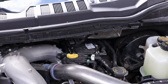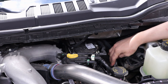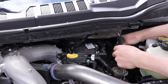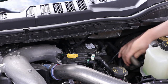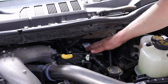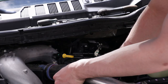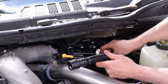This is my first time doing this along with you guys. There are two fuel lines here — a return line and another one. These clips you just have to pull the little white deals and they'll pop out of the way. Then we've got to pull these off. There are a few bolts — 10 mil head — so we'll just start pulling those out. Lines are disconnected, four bolts out of this crankcase filter setup. Now I just got to figure out how this little connector comes off — whether it's a pull or a twist. There it is — got that off.